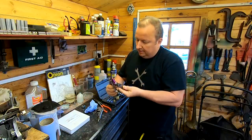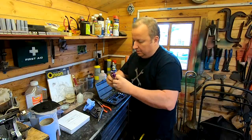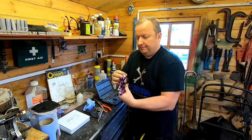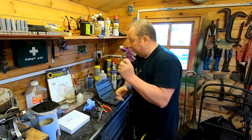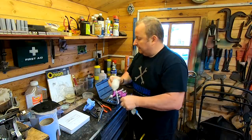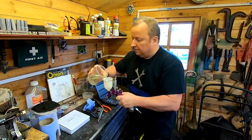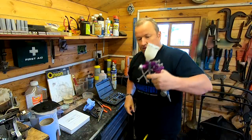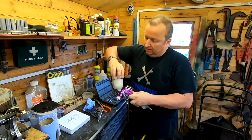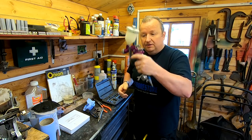And just literally nip, that's it. Air cap on. Like that, ain't got to be too tight. And that I've already cleaned out. Put it back onto your gun. And some people like to leave a drop of thinners just in the cup, as you can see. Ensures you've got a clean channel, and if there is any gummed up pieces in there, while leaving that thinners in there, you're making it nice and clean for the next time.